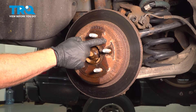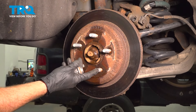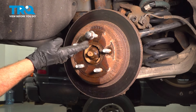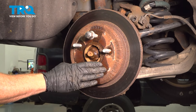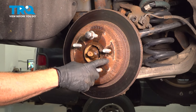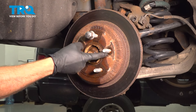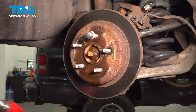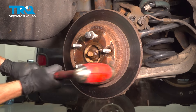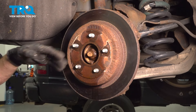Let's move along to removing the rotor. Commonly, you can take hold of it and give it a little tug and it should slide right off. If it's stuck in place, use one of your original lug nuts — start it on just a couple of threads. After that, use a hammer, hitting along the outer edge of the rotor and not on the braking surface, and definitely not hitting any of the threads on your studs. Once it's broken free, we can remove it.